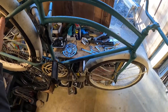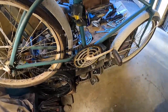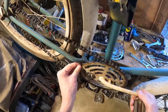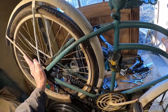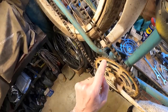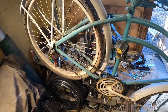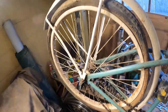Okay, so what happened was somebody rode it so long with bad bearings — they're adjusted now — but they drove it so long it cut into the frame right there. The gear actually cut into the frame a little bit and it's cracked. You can see it better underneath but it's completely cracked all the way through. Well, that ain't gonna cut it. We gotta fix it. To do that I can't weld it with this fender on here or with these cranks on here.